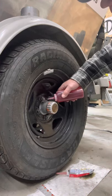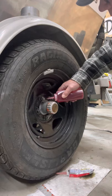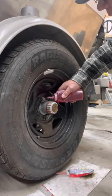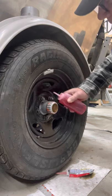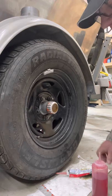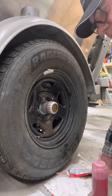I bought this ketchup dispenser at Walmart for a dollar. Anybody that has ever put gear oil into one of these knows how difficult that is — with this I can just gently squeeze the bottle. Go real slow and she won't burp up on you; she'll breathe on her own. One key thing: it takes a while for the oil to travel from the fill hole back to the sight glass, so put a little bit in and wait.